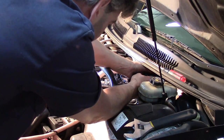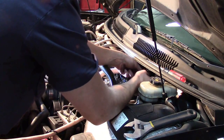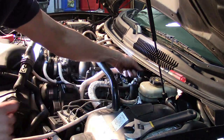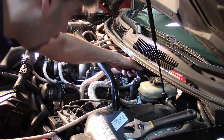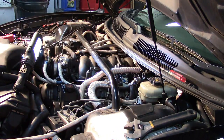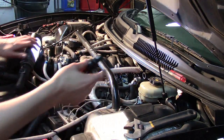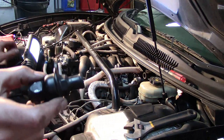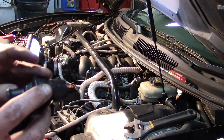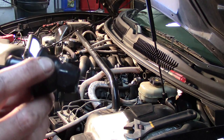For my next tests on top of the car, I'm going to remove this check valve. Since it's a V engine we'd have to do the same on the other side. What I've got here is the air hose from the diverter valve to the left bank of the engine. I want to see if the diverter valve is working, but first I'll test this check valve. It goes in this direction, meaning air should only go this direction. I'm going to blow into it and you can hear the air blows.